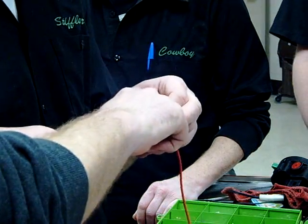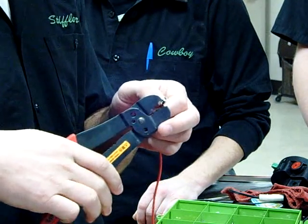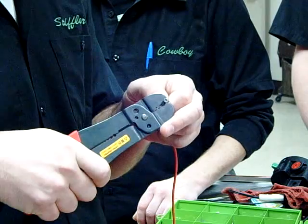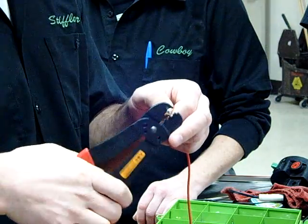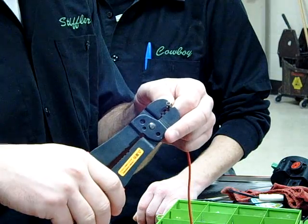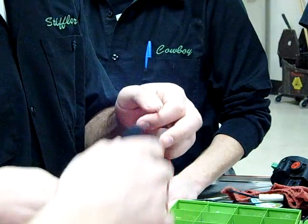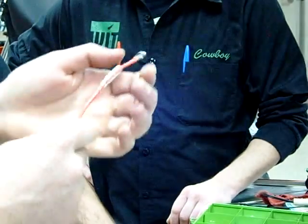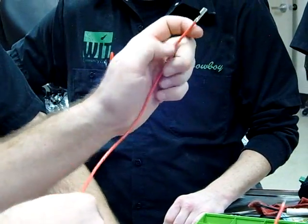That shouldn't have pulled out because he went to the double crimp on the wire part of it. You know how much faster you did it that time? Once you do this once, it's pretty good. Did you get that one good and tight on the insulation? The reality is — if I can pull this off, it's going to pull off when you're pulling it off the harness, because the technician is grabbing the wire to pull it off. So that connector has to be on there good and tight.